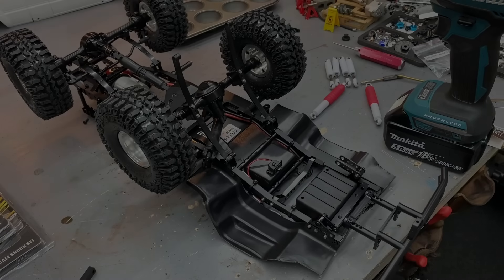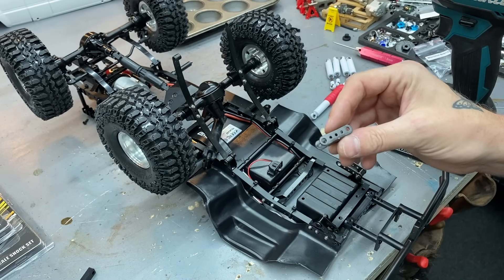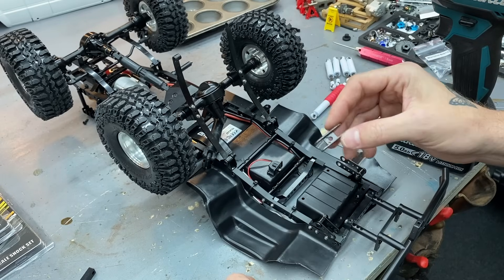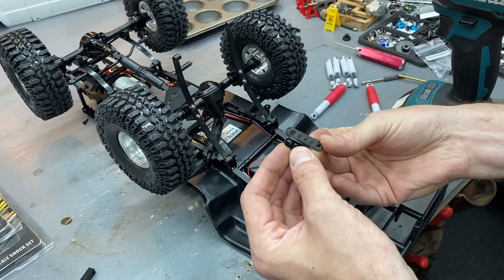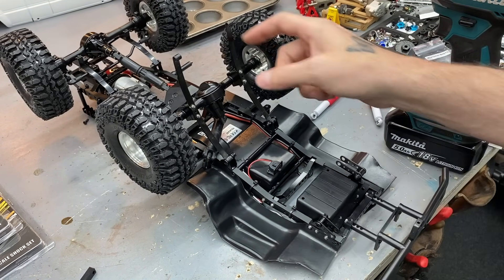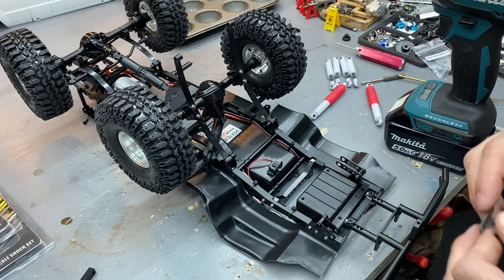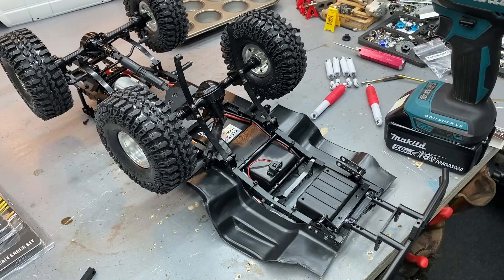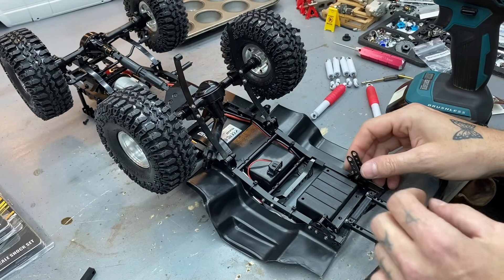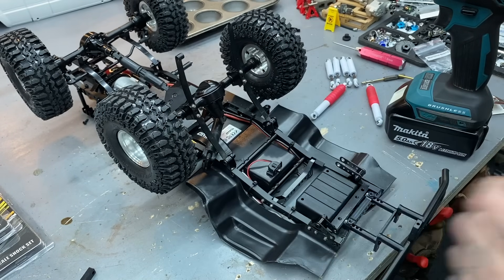More modification. I've got these shackles — I think these come off a generic leaf spring kit from Amazon. They only have one hole big enough for these screws, but they're quite a bit taller, and I hope that's going to give us the rest of the lift we need. I've got some other lift blocks. I'm going to take these angled ones out because I'm pretty certain we don't need that angled correction anymore. I'm going to swap those out for some straight blocks and leave the two blocks at these and see how level it sits.